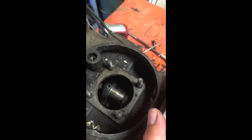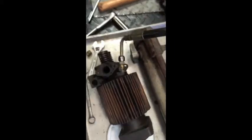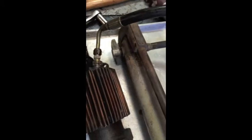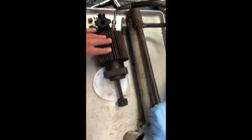We've got the cylinder over here on the bench and I've been soaking it with 100 pounds of air pressure for two weeks and never really got anything to move, never really got any fluid to come out the bottom. So we ended up taking it apart, put a hydraulic pump on it, filled the cylinder full of oil, and Jim, go ahead and pump our situation here and we can watch this piston come out.